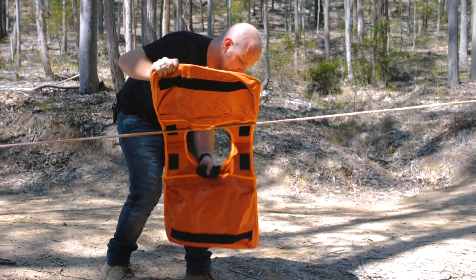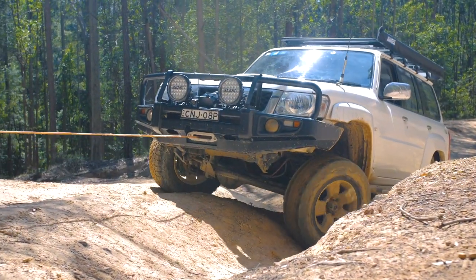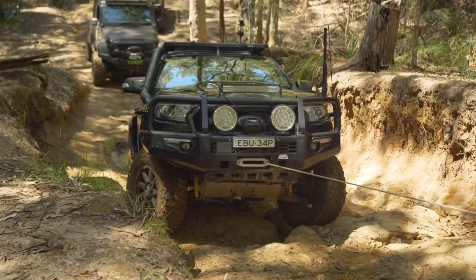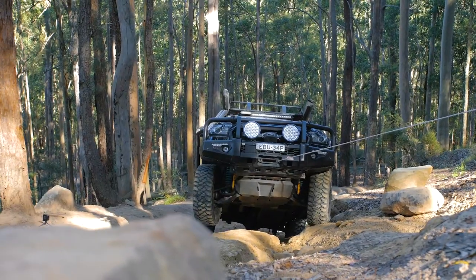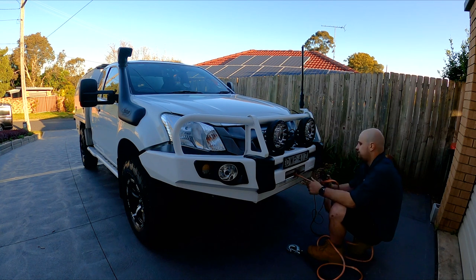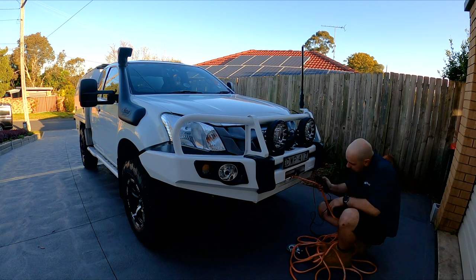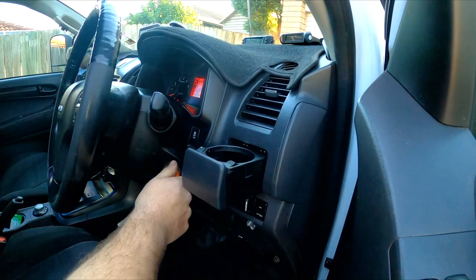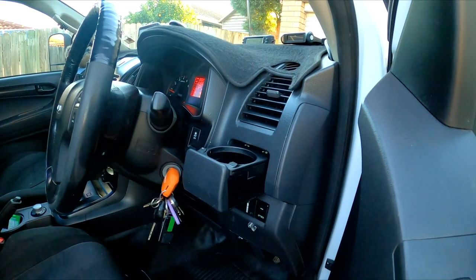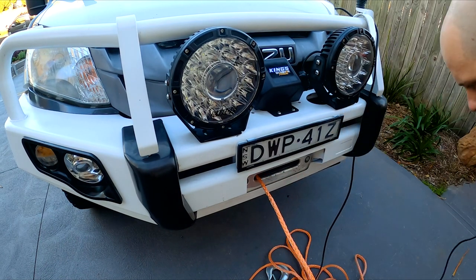Here is the simplest trick you will ever learn when it comes to keeping your winch in good running order. After every four-wheel drive trip, or once a month when you wash your vehicle, spool your winch all the way out and then spool it back in under tension. This gets the motor and the gearbox turning over, gets it warmed up, and prevents things from getting stuck through non-use. Typically you'd spool the winch out by disengaging the clutch and pulling it out manually, but the whole point here is to get the winch nice and warm and get everything turning over, so we're spooling the winch out under power. At any time you're running your winch in or out, it's always good practice to have your car running and just idling — that way you don't risk flattening your battery and you make sure you've got full power going from your alternator to the winch.